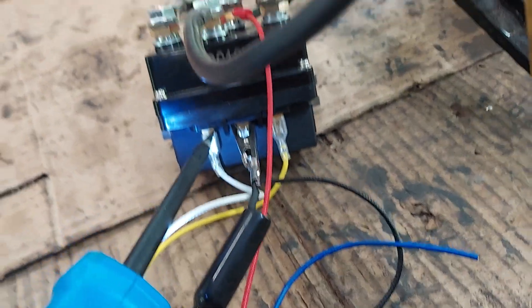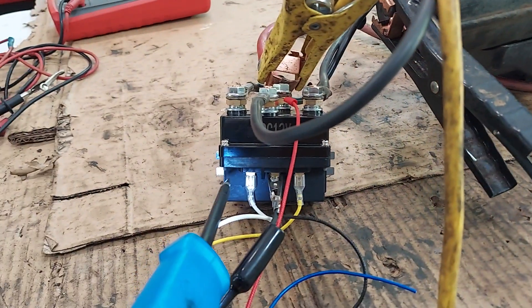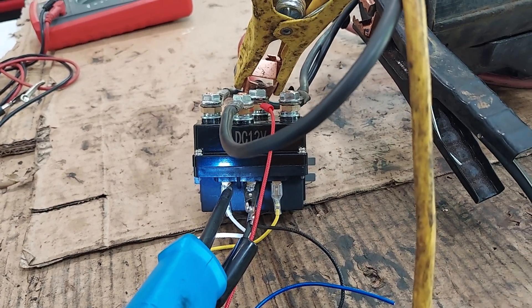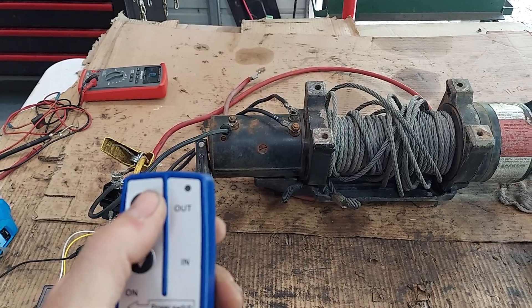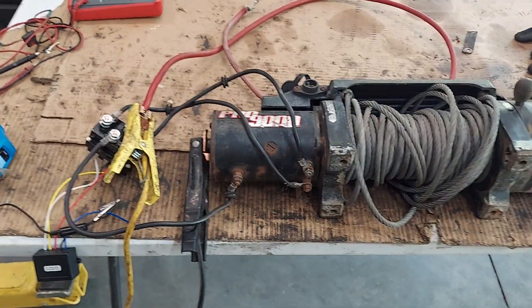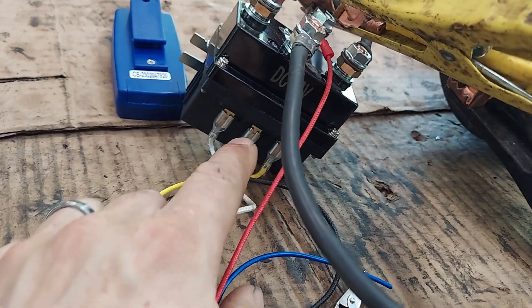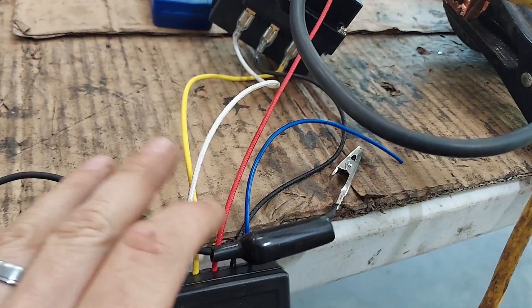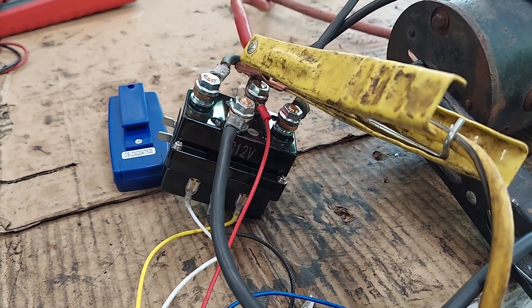When you hit it one way it goes in, and when you hit it the other way it flips back — that's how the old girl works. Power that way it goes one way, power that way it goes the other way. Using the remote — in, out — whoa, almost lost the whole thing! But you see how it works. The only thing it doesn't tell you is you need to add a ground in with this ground — you want the module grounded but you also need to add in a ground on that to get this to work.